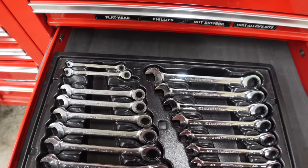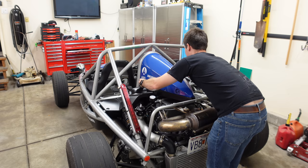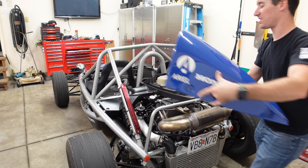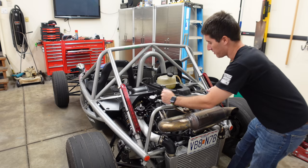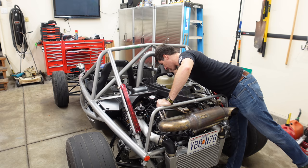We need a 13 and also a three-quarter to get those two sensors. Time to pull the rear nacelle. It does look like I might have to pull all the plastics — I don't want to, but might have to. It's nice how fast this stuff comes apart when you've got race fasteners. The reason I don't want to pull the plastics is because the coolant reservoir has to come off, which is a little annoying. Looks like we lost another bolt — the standoff that holds the vacuum manifold disappeared while we were racing and appears to have fully vanished.